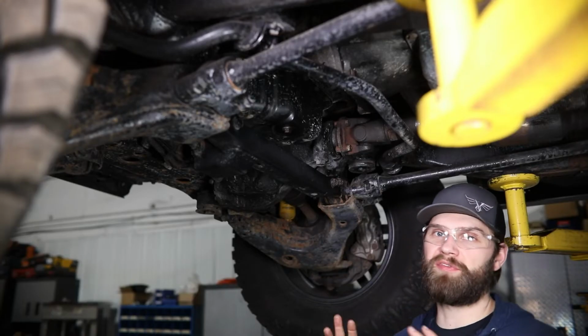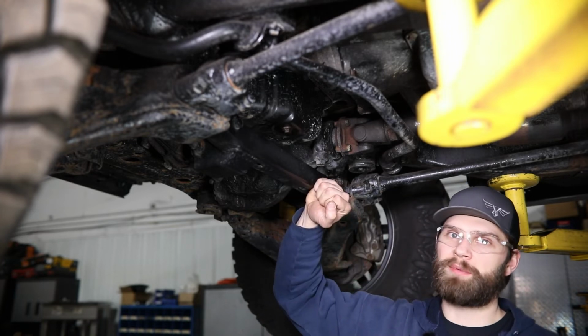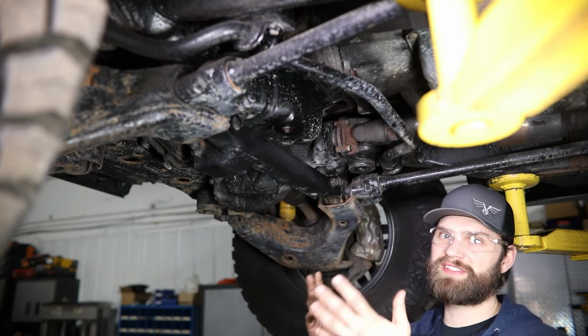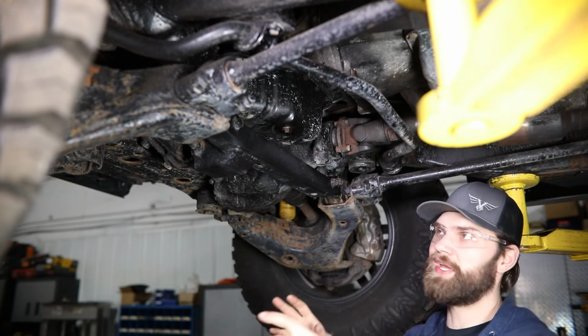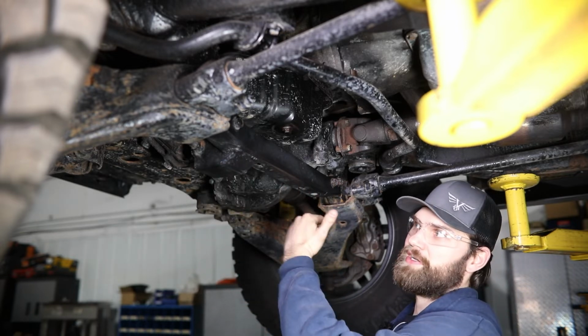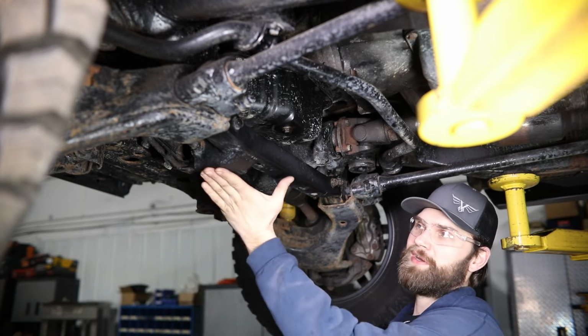So the first step before you can actually get your engine skid in place is going to be to install your diff drop cross member. Now, as you can obviously see, we've already got one in place that was done previously during the R&D and prior modifications. So the one you get is going to be pretty similar to this. It's going to look a lot like this, except this lower flange is going to be all the way across at this same height, not up here.